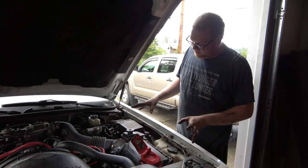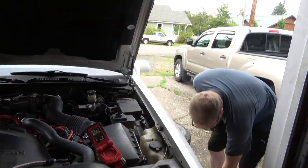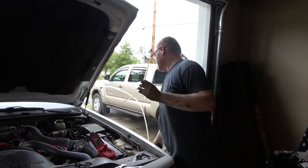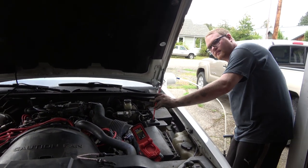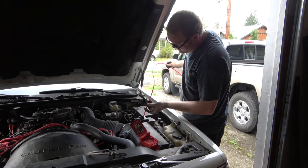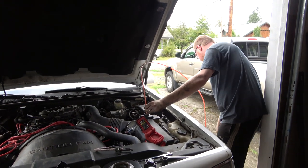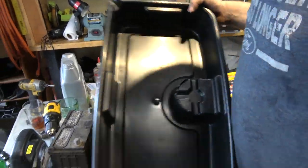What I actually want to do before we get too far is I want to get this thing sucked out. We've got our little fluid extractor — my favorite tool so far. We'll just suck the reservoir out; we're going to put fresh fluid in. It's not looking too bad — I changed it a few times so it's still pretty clean. We'll put this under the car and it'll catch the excess fluids from the power steering.